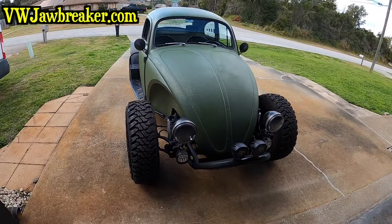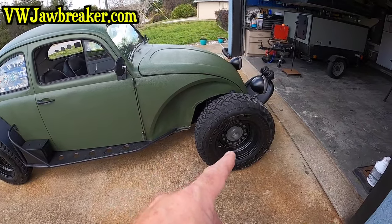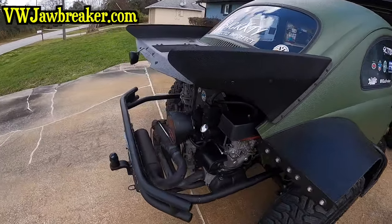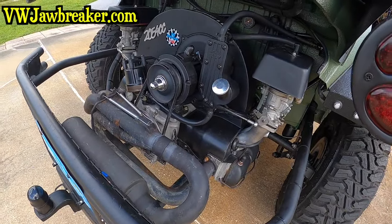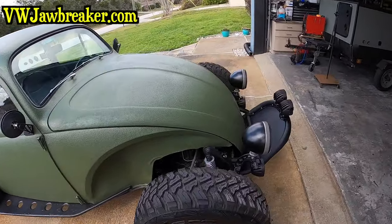The '60s done amazing getting this thing down the road. If you're not aware, this is a 1960 Volksrod Baja Frankenbeetle build that I did. The front end is stretched forward 10 inches, it's kind of a Baja look, we've got a race wing on the back, and we're running a 2054cc high compression big valve engine — it's such an awesome running engine. We've been building this car for about three years, again complete playlist on that. It has done amazing pulling that trailer, except fuel mileage suffers a little bit since I'm cruising like 60-65. I get about 15 miles a gallon, it doesn't run hot, the car handles the trailer perfectly, stops on a dime — four-wheel disc brakes.